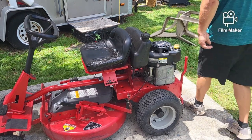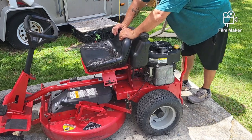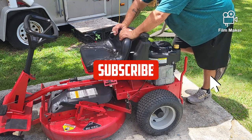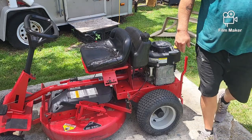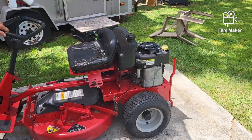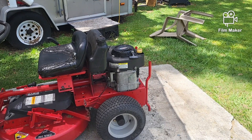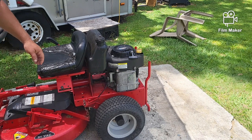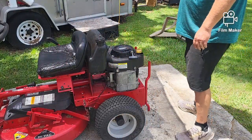And now it tries to start. Because what I did, just like him, was I tried to pull it. He pulled it several times, it would not start. I did the same thing after he left - would not start. And I couldn't figure out why. So first I sprayed a little bit of carb spray in there, thinking, alright, it's probably okay. Nothing. I got zero when I sprayed carb spray into the carburetor. Usually you can get it to bark. So I checked spark, and it had spark. And I pulled and pulled and pulled my brains out and could not get it to start.